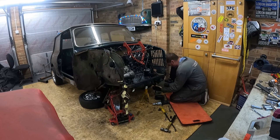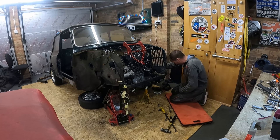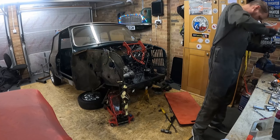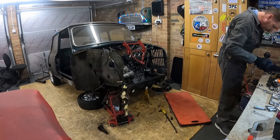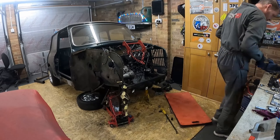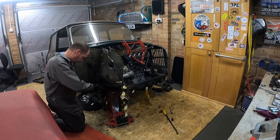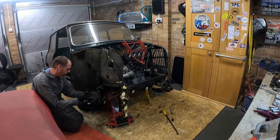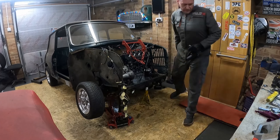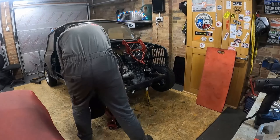I couldn't feel anything while driving it — you'd have thought the brakes would maybe judder a little bit or something like that. You can see here I've actually stripped the drive shafts down and taken the CV joints off the shafts. The reason for that is I still want to be able to wheel the car around in a minute. So I'm putting the hubs back on loosely with the CV joint back in and a hub nut on there — it just holds the whole assembly together, because if you don't have the CV joint in there the bearing can all fall apart when you put it back down on the ground.